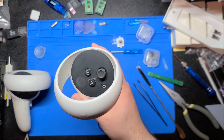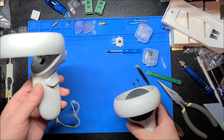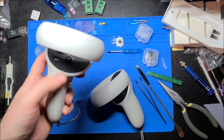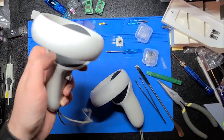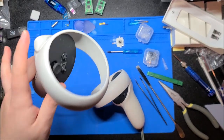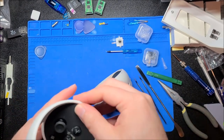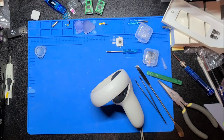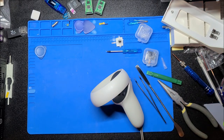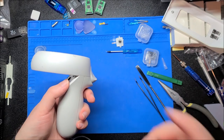He's been having trouble with the joysticks on his controller. This one is already fixed — I need to clean it pretty thoroughly but yeah, it's fixed. I already verified it works off camera, just to make sure I didn't destroy it, since this is not my property and I'm doing it for a friend. I tested it on my Quest and the joystick works, so the replacement was a success. All the buttons work. Now I'm going through it for the camera.